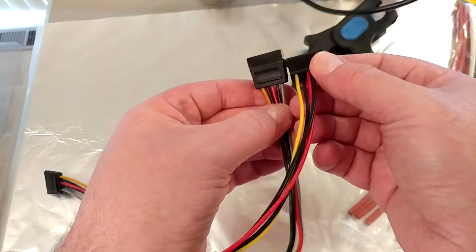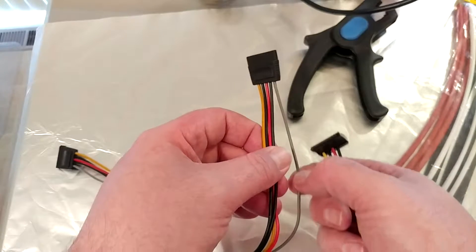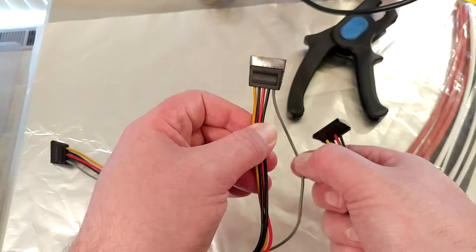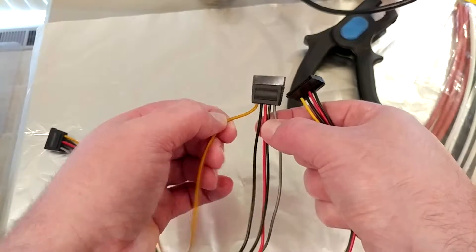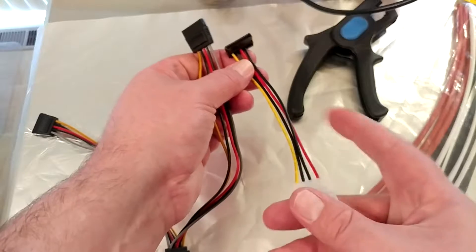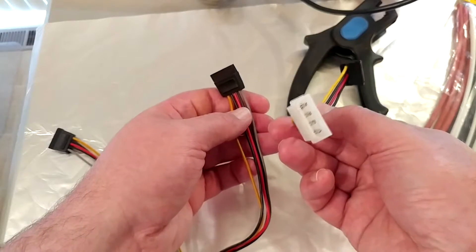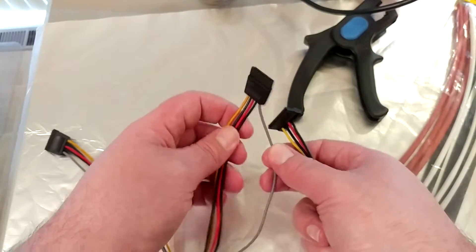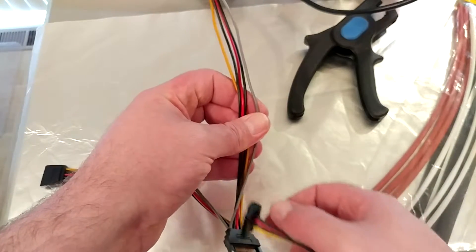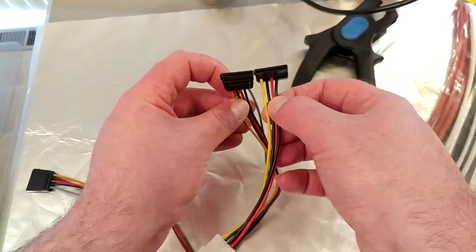The first thing I'm noticing is that our original Y cable has all five wires in it. The gray wire on the side is actually a 3.3-volt reference that's part of the SATA standard but very few things use. The yellow should be 12 volts, there's a ground, 5 volts, and a ground for it. Over on our AT-style adapter we don't have that 3.3-volt reference — there are only four pins. So we're just going to lop that gray wire off and terminate it with some heat shrink so it can't arc or spark.